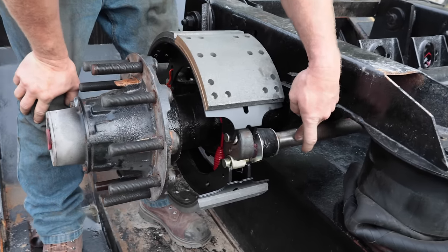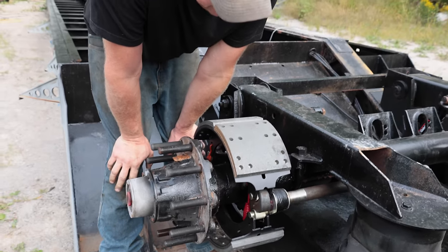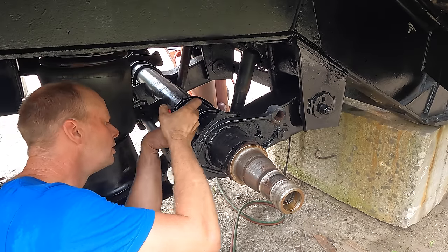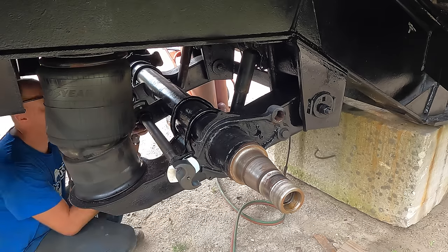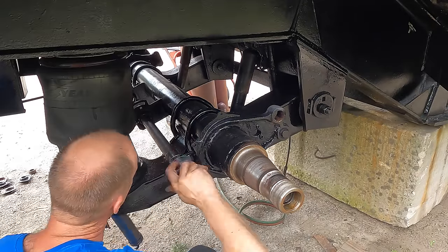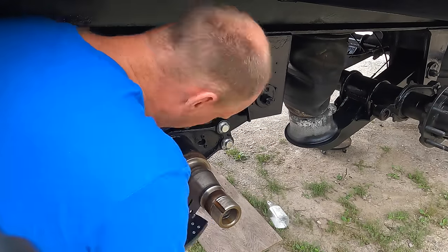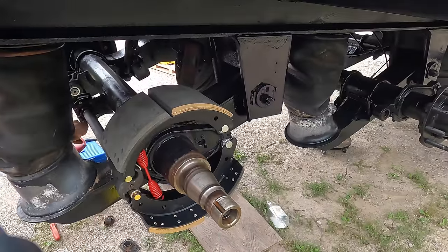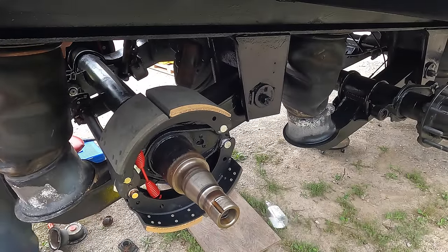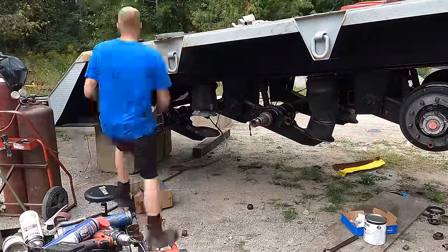That jams the brakes against the drum, and that slows your brakes down. Now, we did not have camshafts. The previous shop took it apart, didn't save any of the parts, and we bought it as an abandoned project. Now, the issue was that I didn't know the length of the cam or what specific cam. So I reached out to Witzco, who told me that I needed a 28-inch camshaft. So that was special order with the serial number.